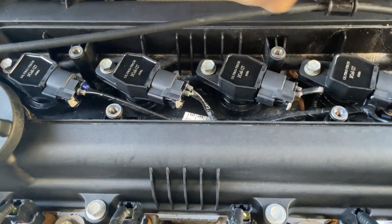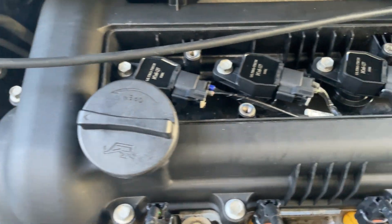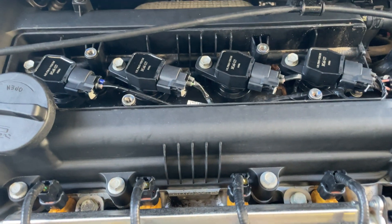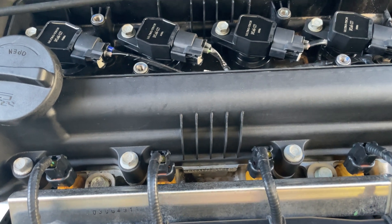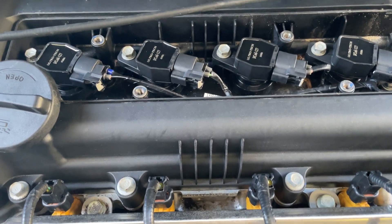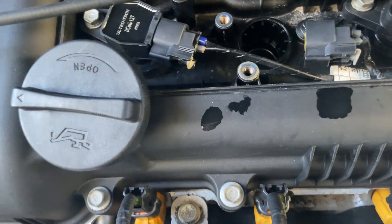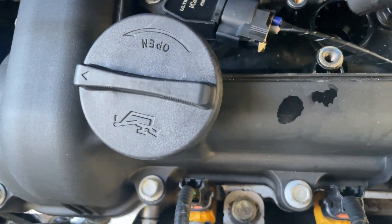There's all the coils. We'll unbolt number two and have a look at the plug in it. It goes one, two, three, four away from the front of the engine which is the driver's side. We'll work out whether the problem is the coil, the plugs, the coil lead or something. We can determine whether it's the coil by swapping it to number one and seeing if it brings up a different code. You just pull the grey tab back on the plug and it slides off the coil - a 10mm bolt comes out as well.